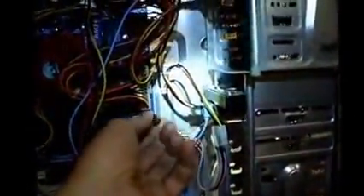This is the piezo speaker — it makes noises that technicians know what they mean when the machine starts booting up, telling us whether it's booting properly or not. On the back are PS/2 connections for your keyboard and mouse. There's a VGA connection; this motherboard also has DVI capability so you'd need a DVI adapter. Here are your USB ports — four of them — an Ethernet connection, and your onboard audio.